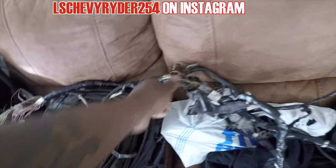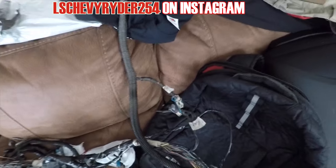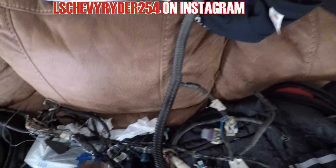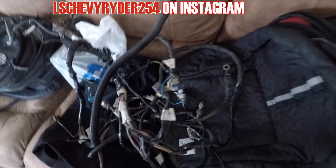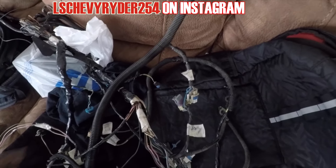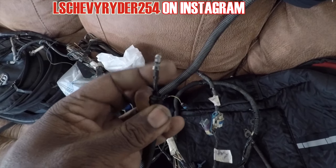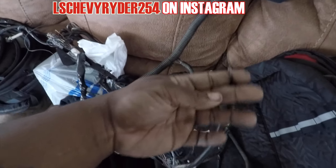I was trying to see exactly where this needed to go so that when the harness lays on the car it would be good. We'll figure it out. The grounds are very, very important. Definitely want to make sure those were good. There's another one, and then there should be one more — and that is actually the one that is missing. We'll have to get a piece; we'll probably just go to the junkyard and splice that in.